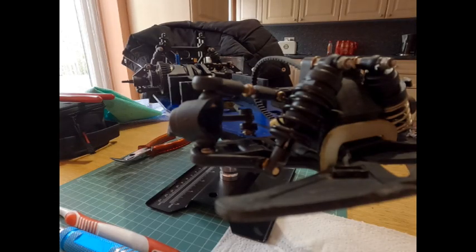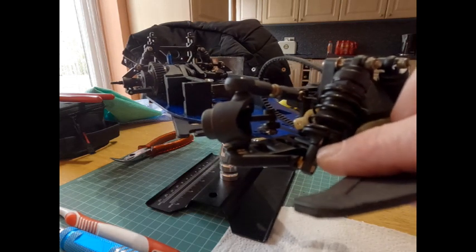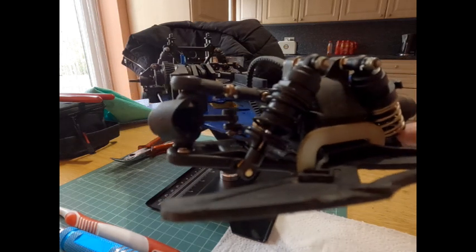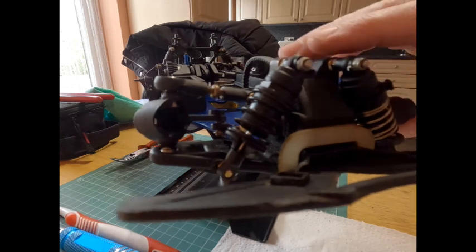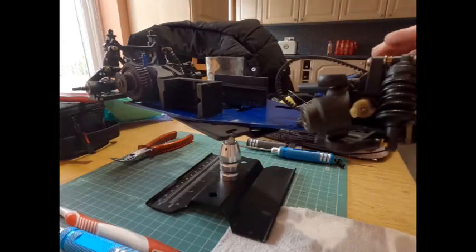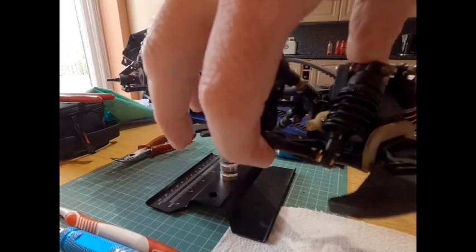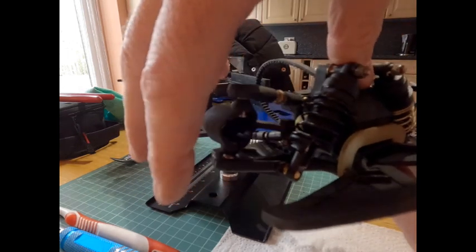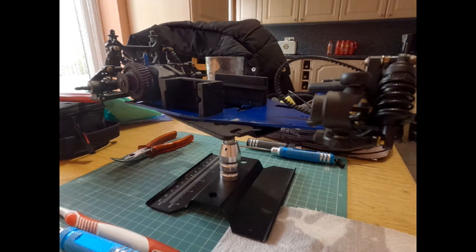And there you have a repaired or serviced shock. The only downside is there's not as much movement on it because the bottom end butts up against the top hat rather than sitting inside it like the original. The other side has no resistance at all - no damping. This one isn't moving too much but it's done, and that's how I'm going to do the other shocks.